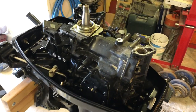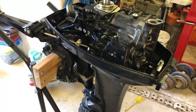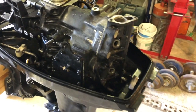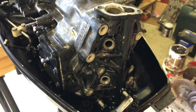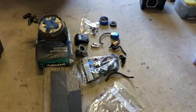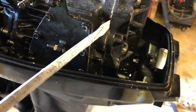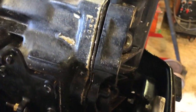Part of the way through this strip down, I've taken all the head bolts out. I try and do that whilst the power head's still on the leg — heat up all of these and try and get them out without snapping any, which I was able to do on this one. Some of them were a bit seized up but yeah, the heat from the blowtorch and take your time, you can get them out normally. I've started sorting out the parts and putting them in bags and labeling them, but I'm just about to pop this head off and have a look inside.